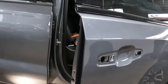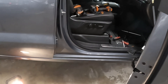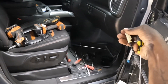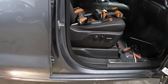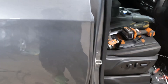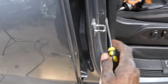Follow the instructions and do exactly what I tell you to do. Just a heads up — with that thing locked in place, when you close this door it won't open back up, even when you try from inside. That piece is locked in place. So take this off — use a number 30 star tip, take that screw from right there. Close the door and put some tape on it to hold the door in place, because if you close this door you're gonna have serious problems trying to get it back open.